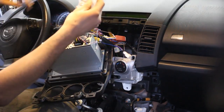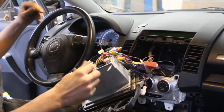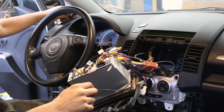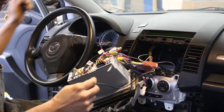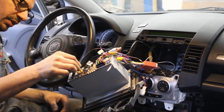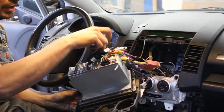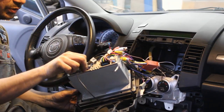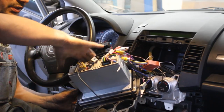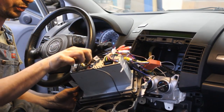And then we also have the GPS antenna, which is very important. Okay, so I run the GPS antenna over here. I don't know if you see it. Oh, it has adhesive tape at the back. Just tap it there. And that goes here in the second connector. Probably for every radio it's gonna be different, so that's why you have to follow what it says on the manual or on the sticker on the actual radio. It says clearly what goes where.